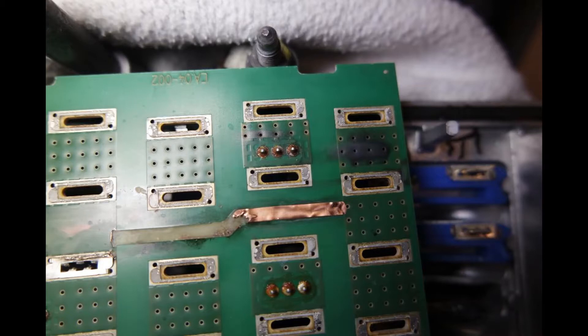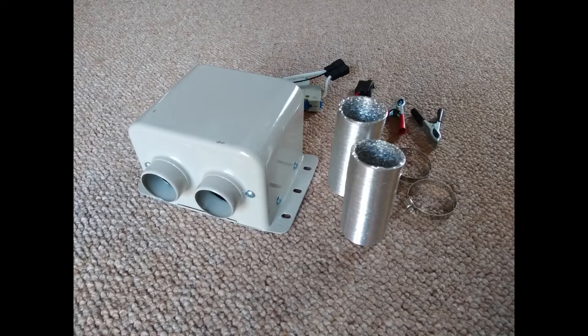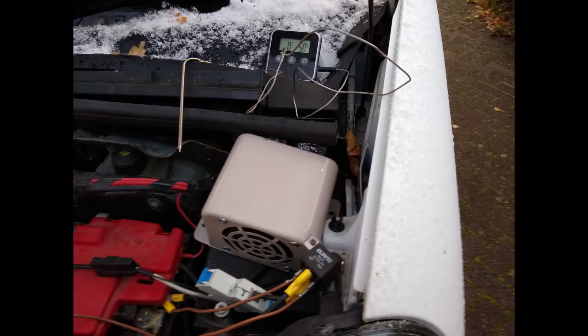They've put a Thermotop diesel heater in their Nissan Leaf, but I thought I would try a 12 volt fan heater in my Kangoo. The heater is switched on using a relay and protected by a trip switch. It blows hot air out of two vents which is then ducted through two hoses. I drilled two holes from the engine compartment into the air intake compartment under the windscreen.